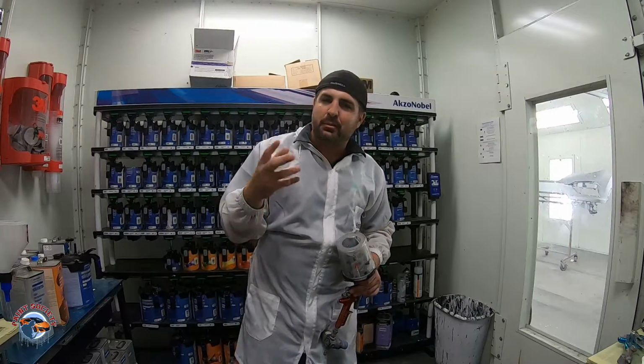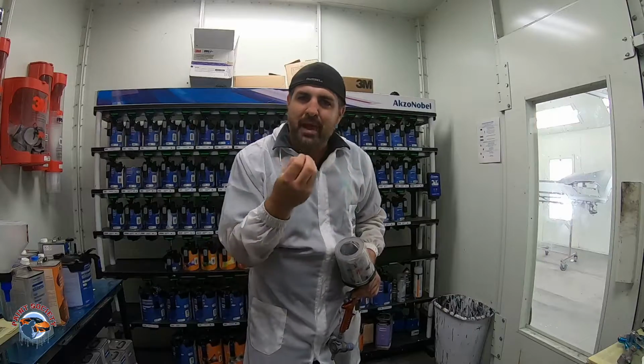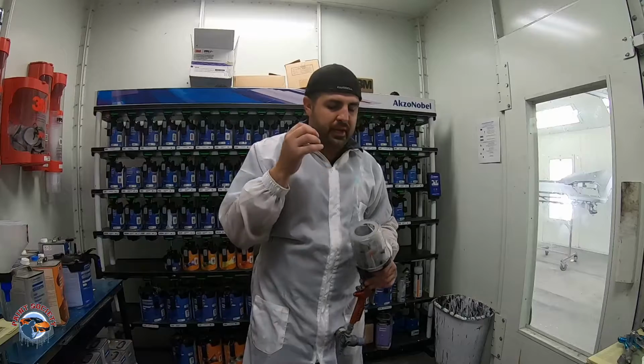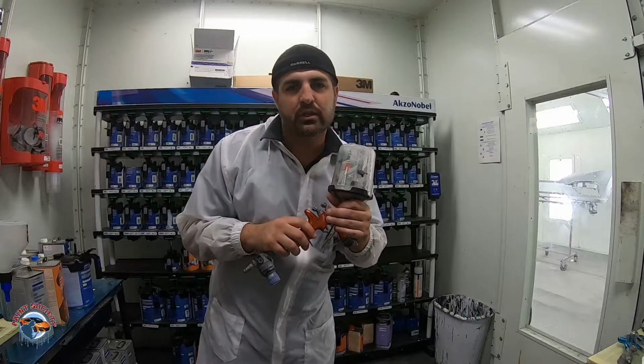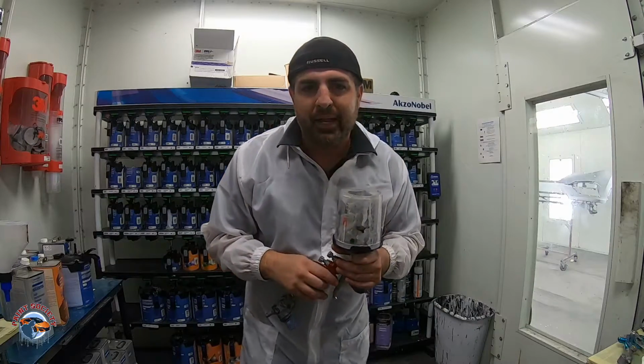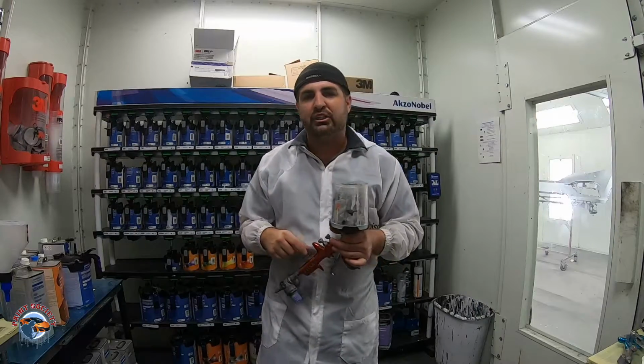The problem was it sprayed great. That wasn't the issue. But the materials inside, what it was made of, the metals, the primer ate through like nothing. So you want the components of the actual physical gun to withstand those solvents and hardeners and whatever goes into the paint, so that it won't actually get eaten alive through the thinner and everything that we use to wash it out. So I went through 3 guns. I could have bought a primer gun.